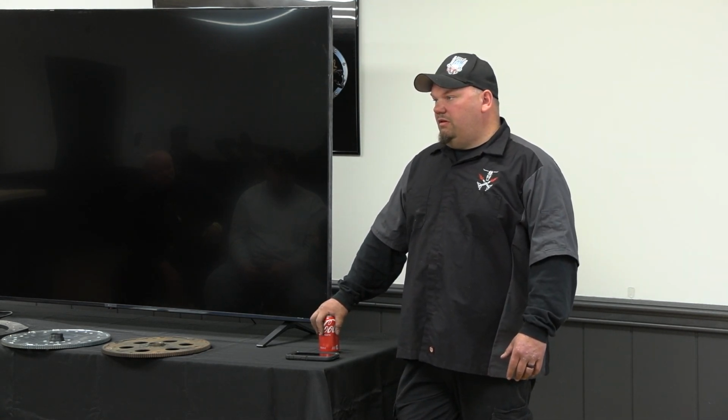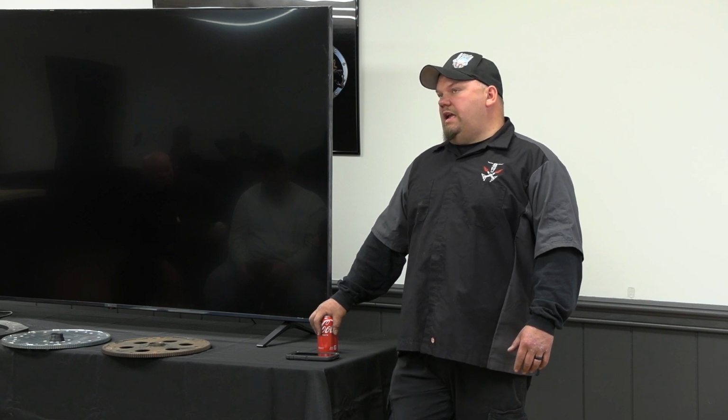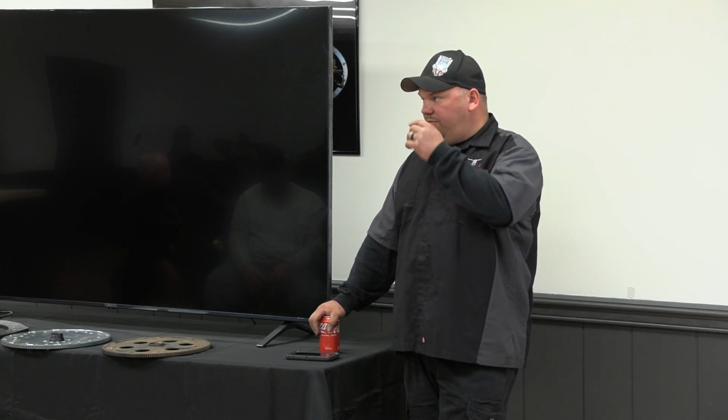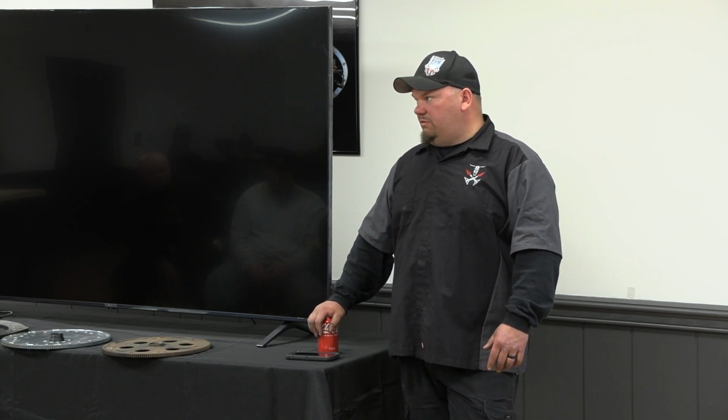So, is that a huge price increase trying to go to methanol, or only the injectors? It is, versus using all the stock EFI stuff. Your engine came with 8 injectors that you don't have to replace. It's a less expensive fuel system.